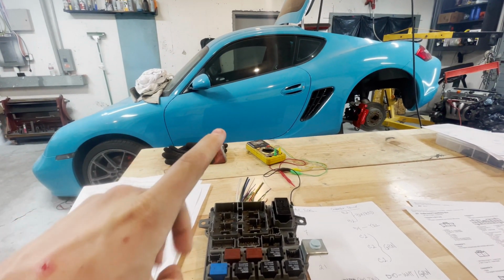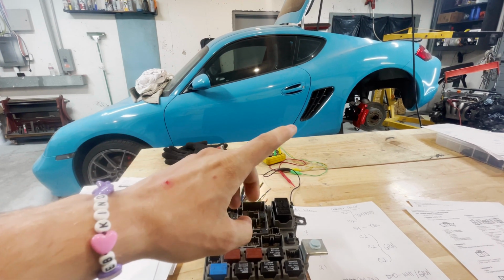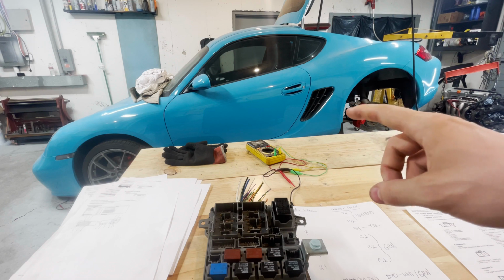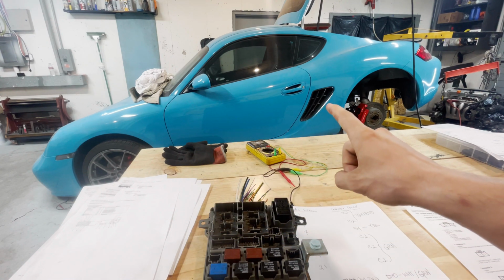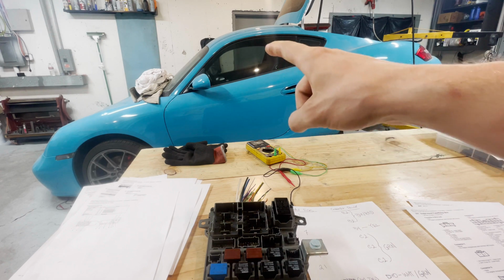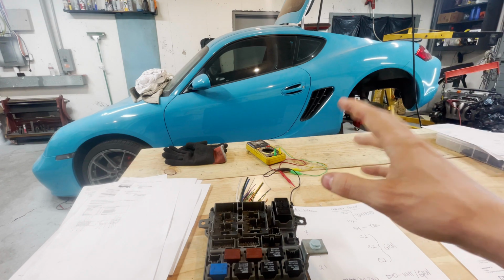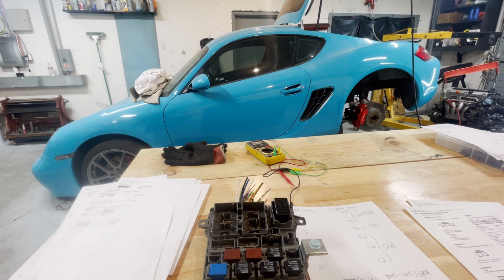If I want to power the windows on this car, I'm personally just going to take the battery cable, and because this is a mid-engine car, yes, I'm taking a front-wheel drive engine and putting it in the middle of the chassis of this car, transverse, but that's a story for another time. So I'm taking the main power and bringing it back, and I'm going to connect it up to that Honda supply fuse, so that when the alternator is getting current drawn off of the windows or maybe the headlights from the actual Porsche chassis, the Honda alternator will change its efficiencies for the draw that is getting loaded for. But that is a story for another time. Right now, we're just worried about the bench test.